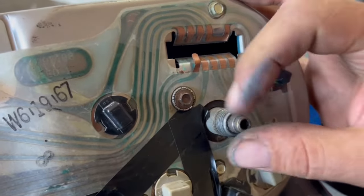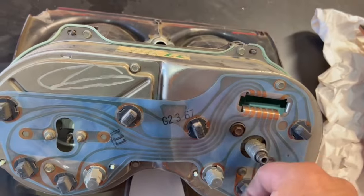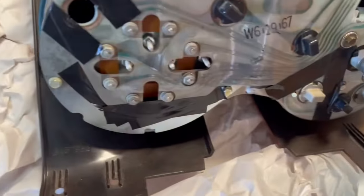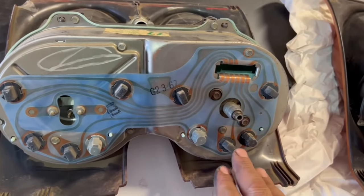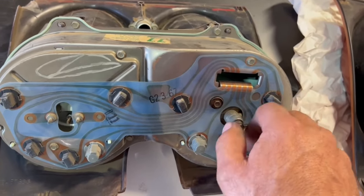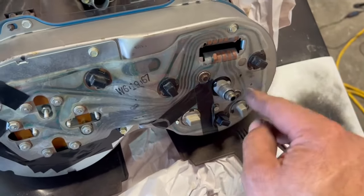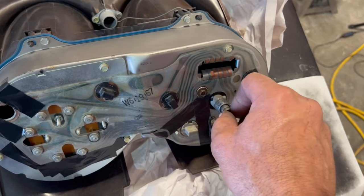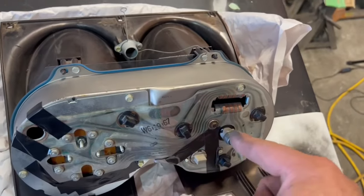Original cluster versus our rally gauge cluster — give this a little whirl. You can almost just drag your finger across it and it'll spin. This side here — no, you actually have to grab with both fingers to get it to turn. For reference, say you had a regular quarter-twenty nut and bolt, not locking — it would spin the nut down on the threads. That's about what the drag is on the good one. Now this here, it feels like a popsicle stick in the mud. There's quite a bit of drag, so I think we need to take this apart and see if we can clean it up. It's not binding like a stuck gear, it's just really gummy — maybe some old grease. Maybe we can flush it out.